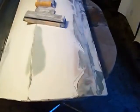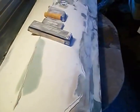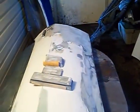And organize my body shop here in my addition I made. And my doors finished up with some polyester filler putty to get all the imperfections and pinholes filled up on my hood, and the doors, trunk lid. And fenders over there.